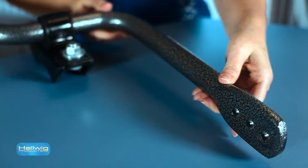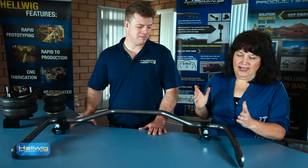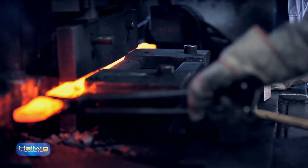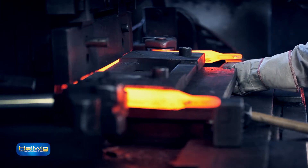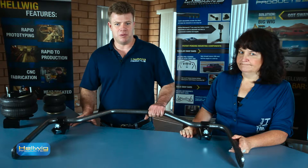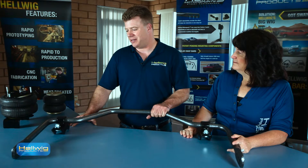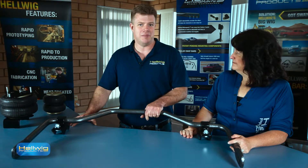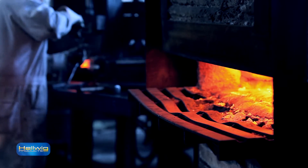Check out this sway bar. Dave, can you please tell us a little bit about a sway bar, the manufacturing, and why it's so important? All Hellwig sway bars for truck applications are made from 4140 chromoly steel that's heat treated to a tensile strength of 180,000 psi. Heat treating a sway bar is important in a truck application because the articulation that a truck sees can fatigue and break a non-heat-treated sway bar. Unless you heat treat the chromoly steel, you're not going to get the tensile strength — heat treating doubles the tensile strength of the steel, providing fifty percent more fatigue resistance so that the bar will not fatigue and break in a demanding application.